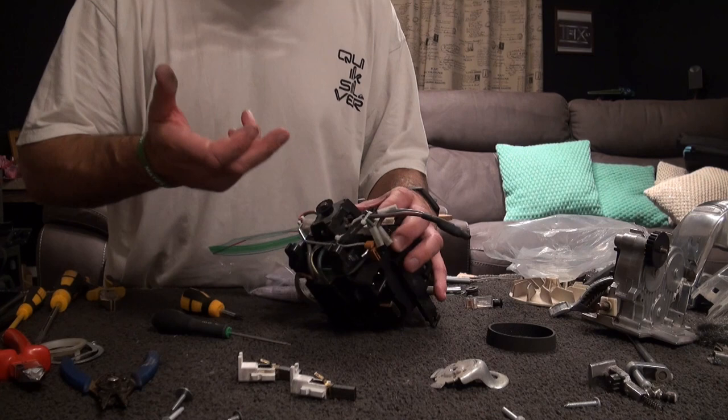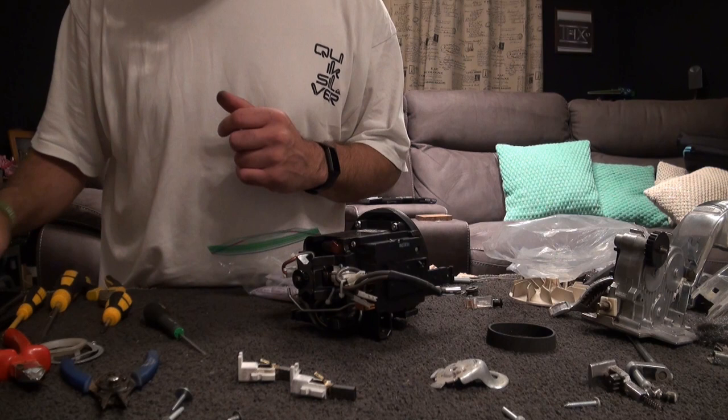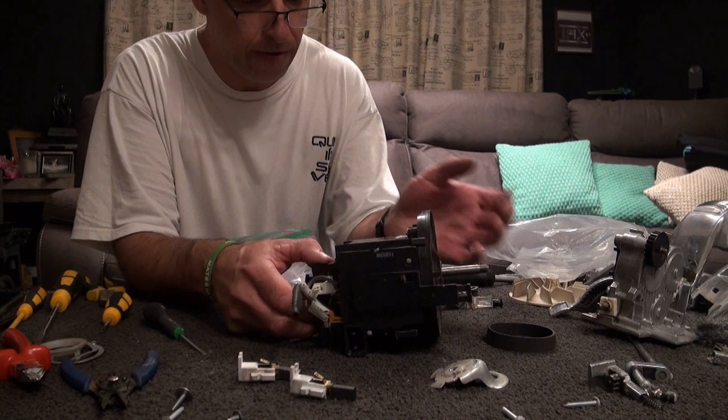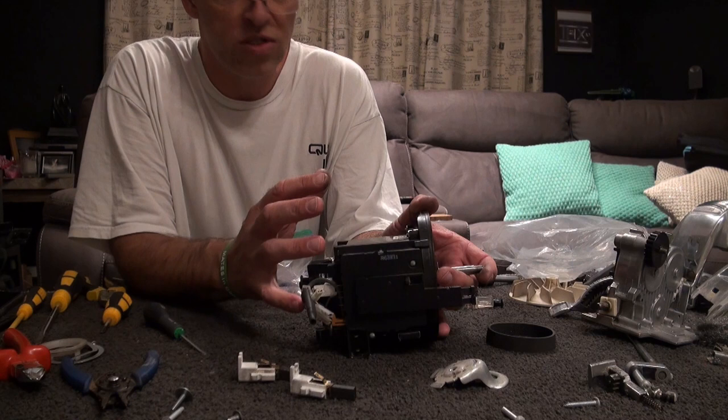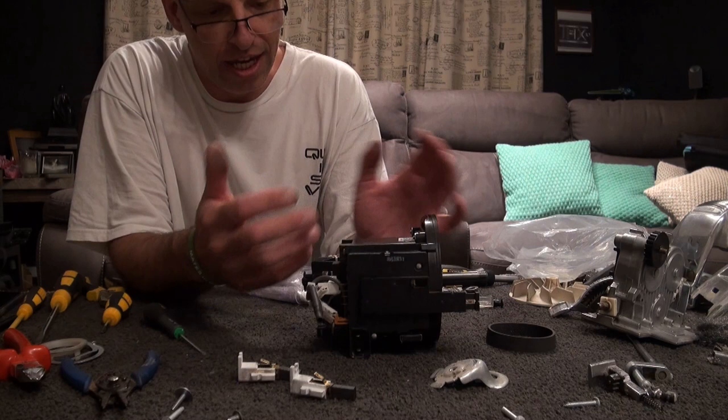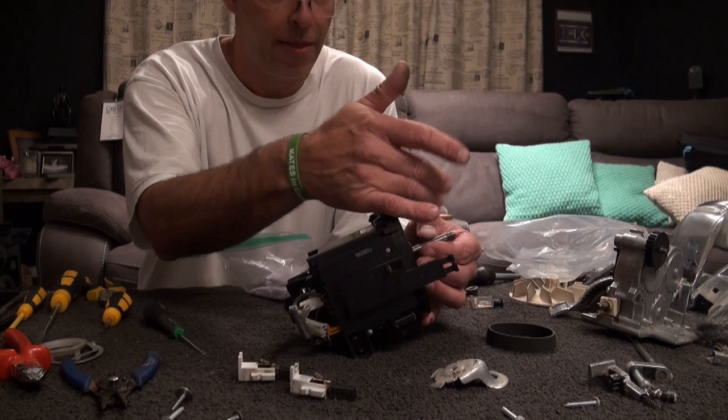So next up is the fan, which I'm going to do first. I might come back to that. What I'll do with the fan is I'll fit that last, because I'll show you guys how to change your fan. If you just want to change your fan, you haven't got to take all your Kirby apart. You can just take the front off. So I'll get it all back together, and I'll fit the fan last so that you guys can see that you've just got to break the seal on the silicone. You can get to the fan, just take the top off your Kirby, get a 10mm spanner on here, and then undo it. Okay, so we'll get to that in a minute. So back in a sec.